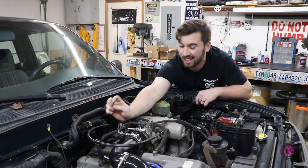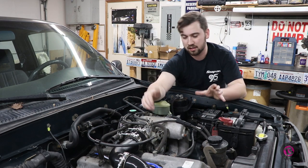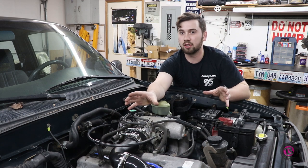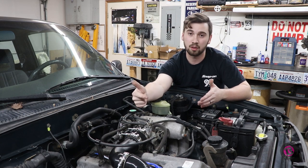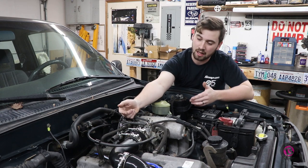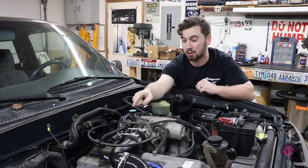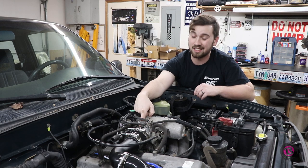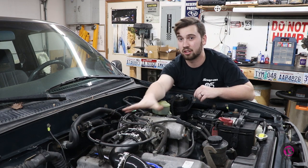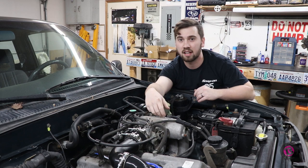And then I'm also going to add one more thing, which is a check valve. That is a good way to stop all your components that you don't want boost getting into from getting boost. So we have a check valve that allows air to flow into the manifold but not away from the manifold, so that when we're building boost with the turbo, which we're not necessarily requiring the action of the idle air control valve at that point, we're not losing any boost through that line.